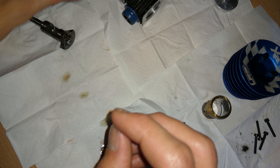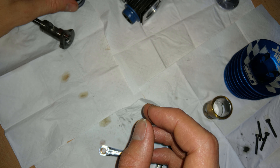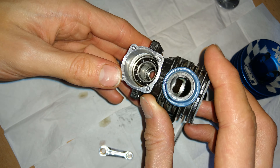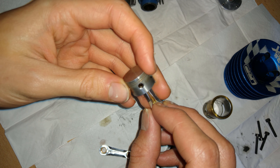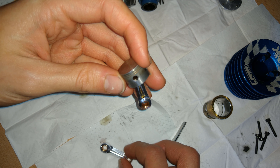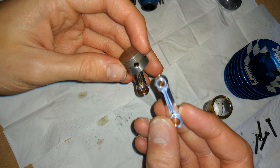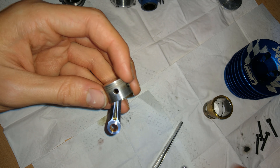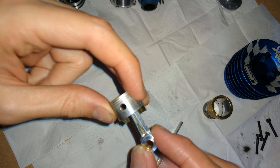That's perfect. I also cleaned the back plate — look at that, like new, that's how you want it. On top of that I also cleaned the block. Now we're going to change the connecting rod. This is the piston with the current connecting rod — you can see it has quite a big oil groove, whereas this new one has a much smaller groove, but it's the same rod type, so we're going to change the rod.